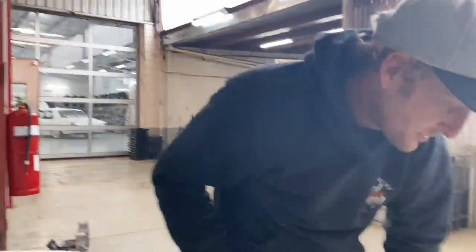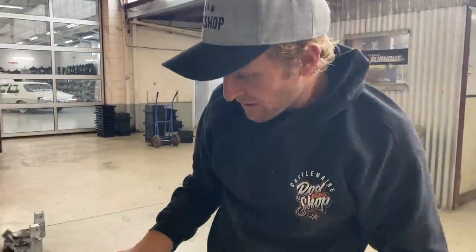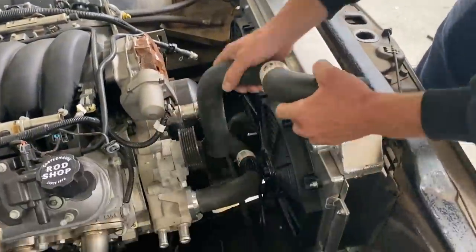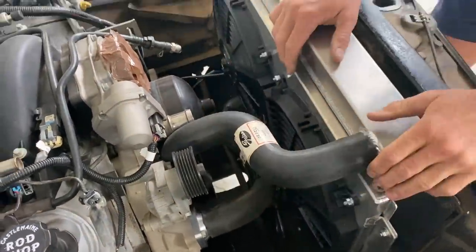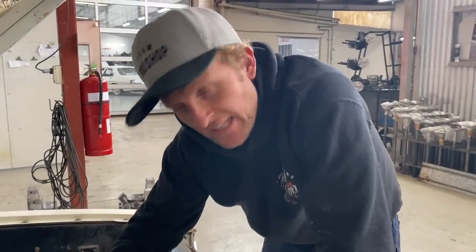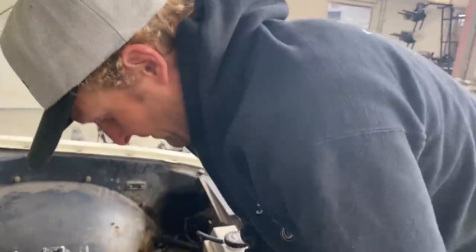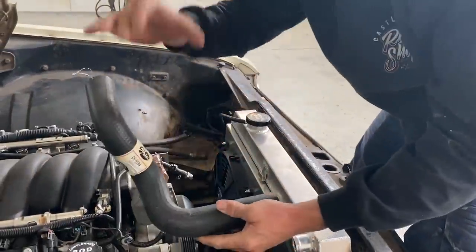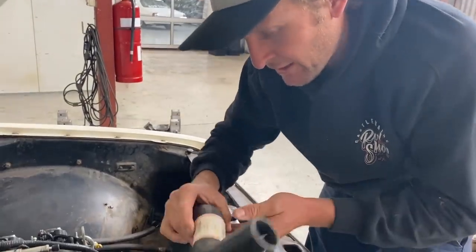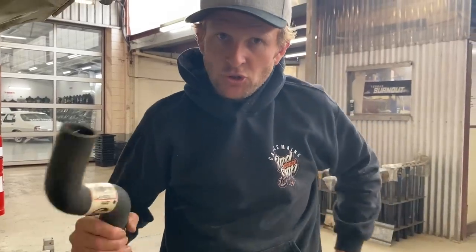You've got the number of the hose — we know what we've got to do, so we'll move to the upper. We were going for the S-bend, which was the little one. First issue — we're a fair bit short. If I try and extend that hose across we're going to kink it, it's not going to happen. The other end has a bend kicking the other way. The VL Commodore 5-litre one is not going to work. I'll jump in the car and go down and swap it over. In the meantime, just in case we've got anything else wrong, we'll go to the heater hoses and make sure they're all good.